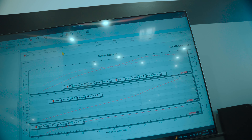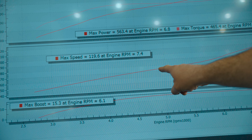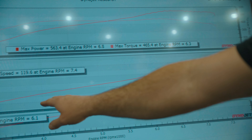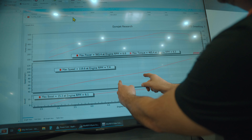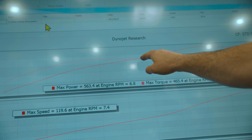We're up to 15 pounds of boost on Billy's twin turbo Z and we're running into a little bit of slip. We need to determine if that's from the tires against our smooth dyno drum. We prepped the tires with VHT, lowered tire pressure, and got Billy in the back for added weight. This line needs to be as straight as an arrow — you can clearly see how it dips considerably right here, which is going to affect our readings.